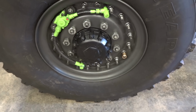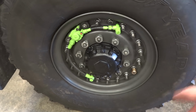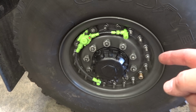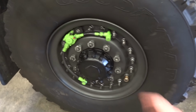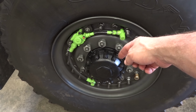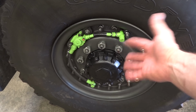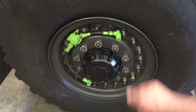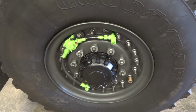So okay, we let this thing sit overnight. Came back, monkeyed around with the wheel weights, but that's a different video. Ran it for another hour, and then we got the same temperature on both hubs. So I'm happy about that now. So probably whatever that grease is that I used to hold the shim and the thrust bearing onto the hubcap caused it some extra friction, or it just didn't get any lubrication in there fast enough, which caused the higher temperature. But today it seems to be doing good. So I don't know. I'm going to call it good. I'm going to call it happy.